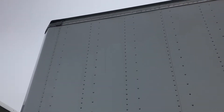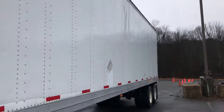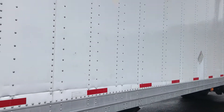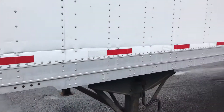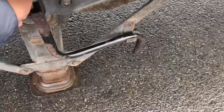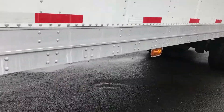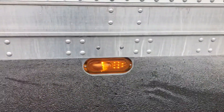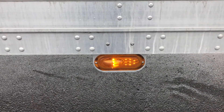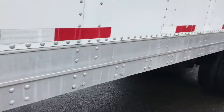If I have a light up on top in the corner, that would be my clearance light — amber in color, clean, not cracked, working properly. Side of my trailer is clean — no holes, no damage. At least 50% of DOT reflective tape. My landing gear handle is in lock position. My mid-trailer left turn signal light — amber in color, clean, not cracked, working properly. If they ask me, it also indicates my trailer is 30 feet or longer.